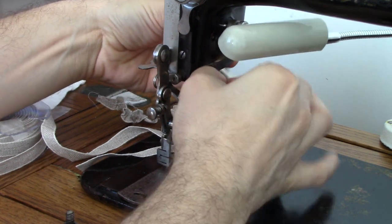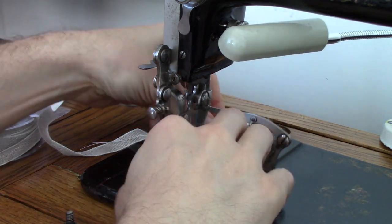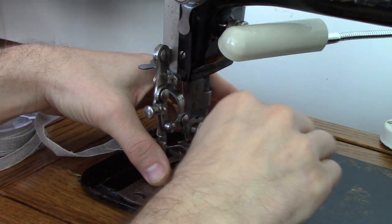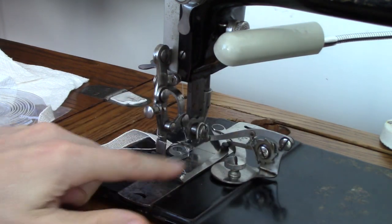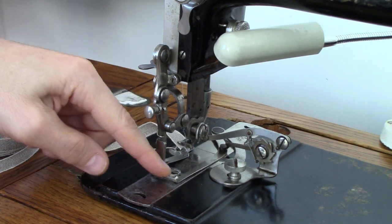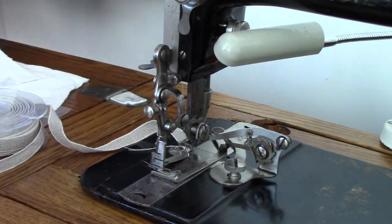It's a little bit fiddly getting in there with the camera in the way, but that's okay. You hook that over the needle bar - that's the easiest thing to do first. Then what you have to do, and this is part of the adventure, is to lay this flat. Sometimes it's easier to drop the needle so that it naturally will want to lay flat. Then we can line up the screw. What I found is pushing it all the way over helps. What I noticed about this particular contraption is when I first got it, this bar was a bit bent - it was raised up and would hit the ruffler. You need to make sure that's good and flat so it will slide underneath the ruffler.